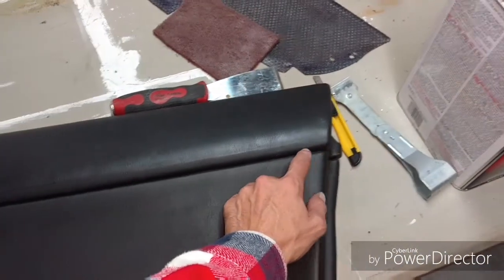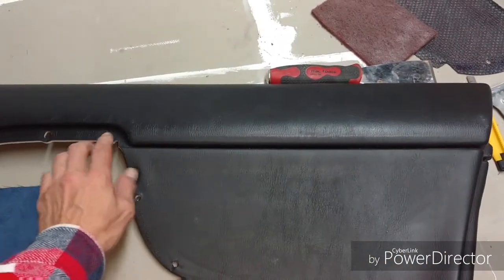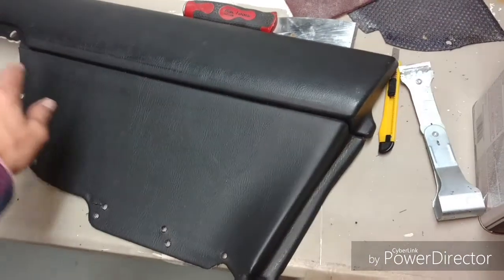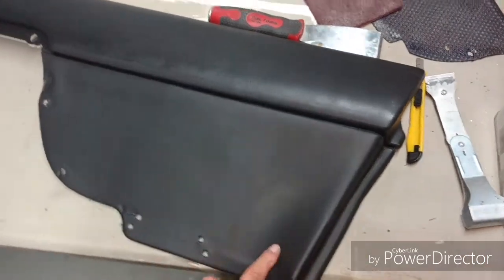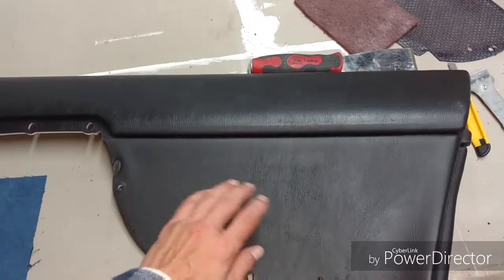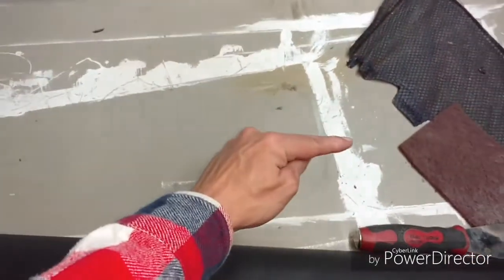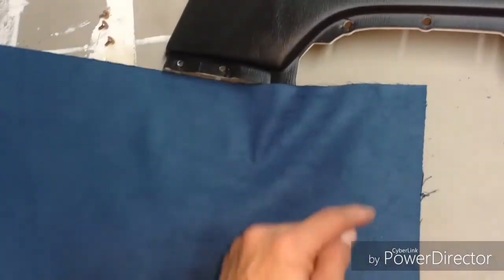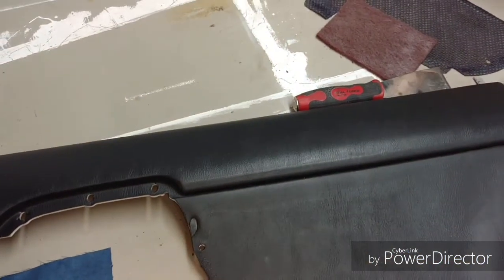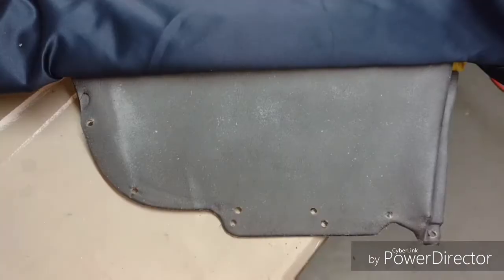Here is where we begin our fold and transition of tucking — that's actually the hardest part, getting the seam down and making it look as flawless as possible. Everything else will fold under or be hidden by the door panel. Do this first, because you don't want it to be the last thing. I'll score the fabric all the way across in a tight line so you don't have frillies, then start with the tucking and move on to getting it mated and finished to the door panel.